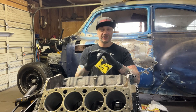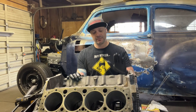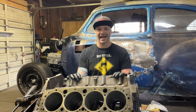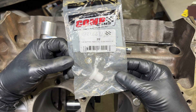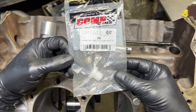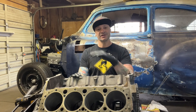After a couple of weeks, there was just no way to make that roller cam button work. The best solution for this engine is to go with the old tried-and-true nylon cam button. The beautiful thing is you can cut it down to exactly the size you need. This is a Comp Cams part number 202 — it specs at 810 thousandths, bigger than needed, which is what you want because you'll cut it down. I'd recommend ordering two of them since the chances of screwing up the first one are pretty high.